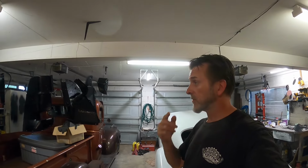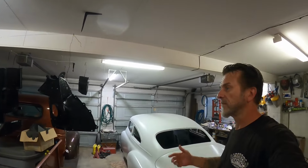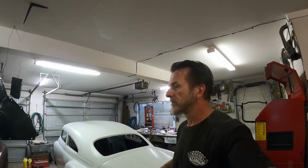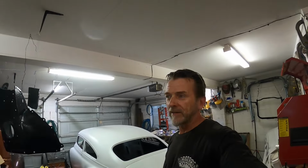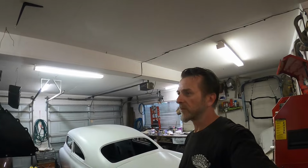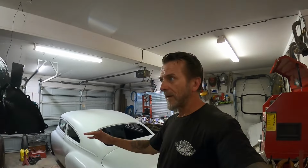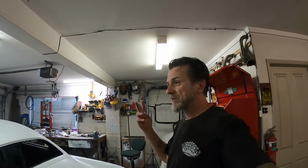I actually did talk to my brother-in-law yesterday. I did paint one of his cars, a 51 Chev four-door actually, with a satin 2K, and we got orange peel in that too. So I shot it for him, he prepped it, and I had a crack at painting that stuff, and we ended up thinning it down a bit, I think, from memory. I was confirming with him yesterday and he was saying, yeah, we did knock it back to get it to lay out nicer. So I have to keep that in mind, either that or it's still my gun settings or something like that. But anyway, I'm happy with them as they are.